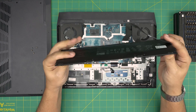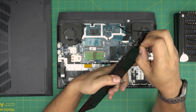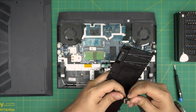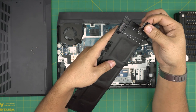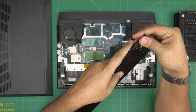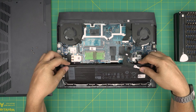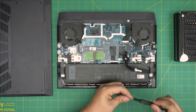The new battery doesn't come with the cable, so remove the gaffer's tape and transfer it over. The jack just snaps in place — push it down from the top side. Grab the new battery, align the cable on top, push it down, and put the gaffer's tape back over it. Route the cable the same way it was, slide the back end towards the front of the laptop, set it down, and put the four screws in first before connecting the battery.